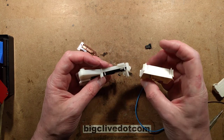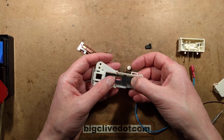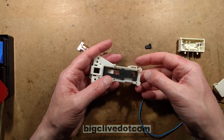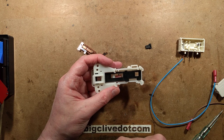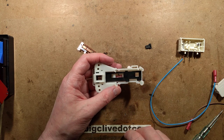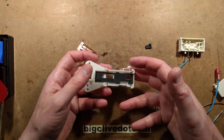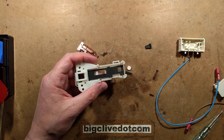Now that it's been unlocked, it lets you take off this, which gives access to the sliding plate in here. The spring just goes into a recess in the plastic when it pings out. That's the little sliding plate. Very clever - but that's pretty much like every other component in a washing machine: just optimized for mass production and low cost. Very, very neat indeed.